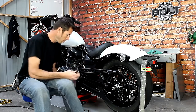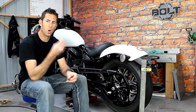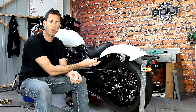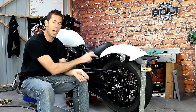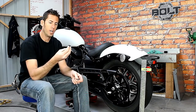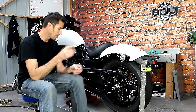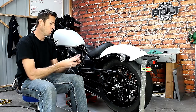We have supplied this hardware. This hardware is only to be used when you're using the stock fender. If you're going to remove the stock fender or use a different fender where you don't have these fender mounts, you can use the stock hardware to put these on. This hardware is powder coated and comes with a powder coated washer. You want to put Loctite on it, which is also supplied, before you install it.